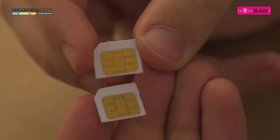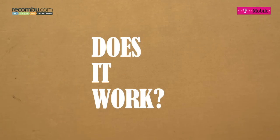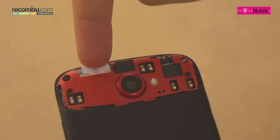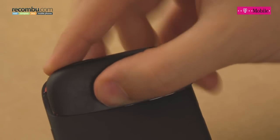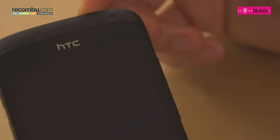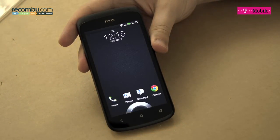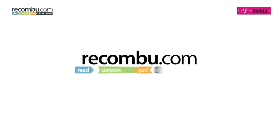Compared to the other cuts, it's looking pretty good. So you've got your cut SIM — push it in. This particular phone has a click mechanism so you know it's secured in there. And it's really just a case of putting the battery door back on and turning the phone on to see what happens. As you can see, the phone's registered the SIM card and we've got some signal. So that's how to make a microSIM.